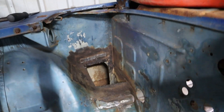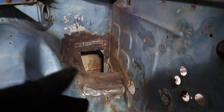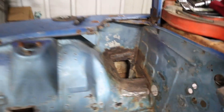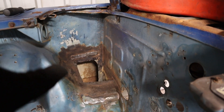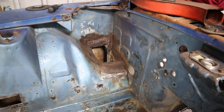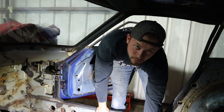As you can see, all of this basically fell apart when we cut out the old battery box. So the battery is going to get relocated to the back — we need to put a fuel cell back there anyway, so why not throw it back there too. That leaves more room for fun things in the engine bay. I was sitting there working on it for about 30 minutes trying to get it cut down, grinded down, and get to some bare metal, but it was just full of rust. I think I got it to the point where I can weld to it now. We only have about an hour left and then we have to clean up this huge mess.